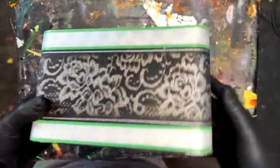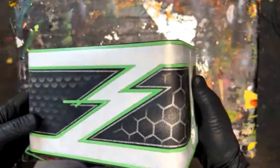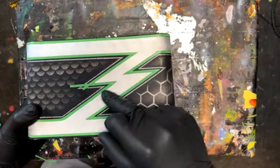We'll go ahead and mask it up here, and we will run our candy again along this edge, feathering both ways. So giving it a nice blend, really cool look. I was really happy with it when we did it last week. This week, I'm going to take it a little bit slower. We're going to lay the candies out not so heavy and not so fast, because when I pulled that tape layer, I had such a buildup on the edge that it just sat longer.